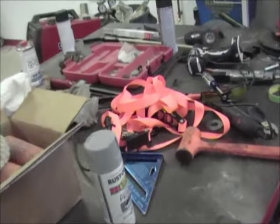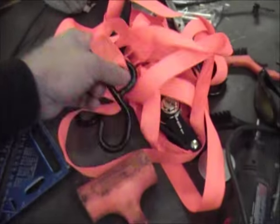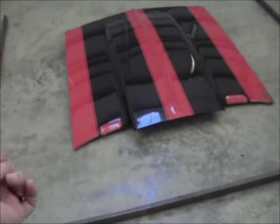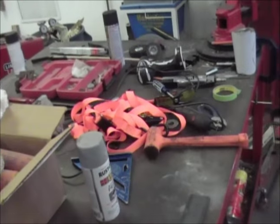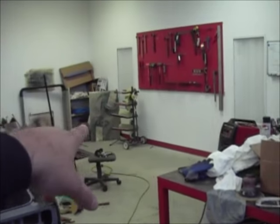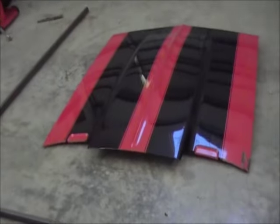Basically in the shop what we did was use these little guys with hooks on them — you put your bolts in the back of the hood and hang off the bolts. You wrap these up with paper so none of the fibers or threads get in your paint. Then you can get to the front and the back. Back there with my lights it would be a lot like a paint booth — you've got your light shooting across it so you can see what you're doing.